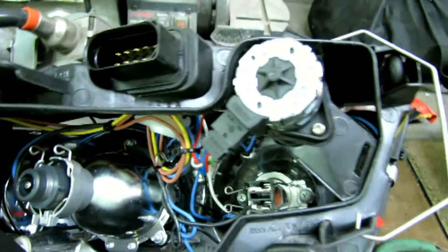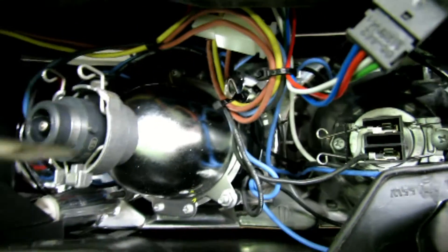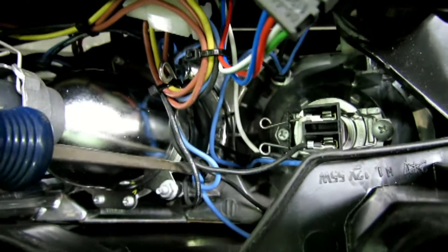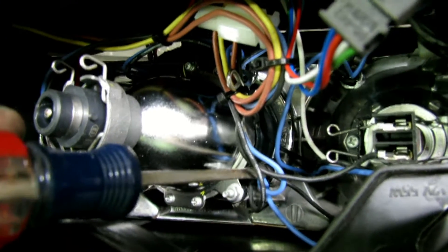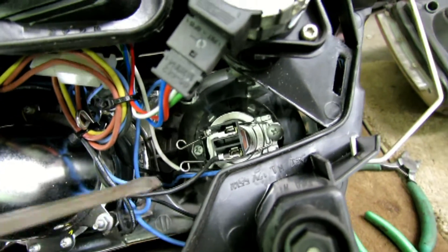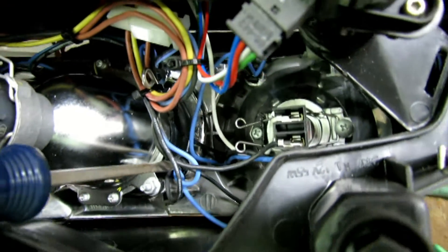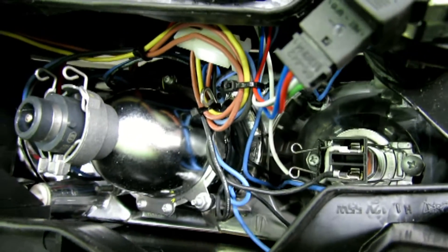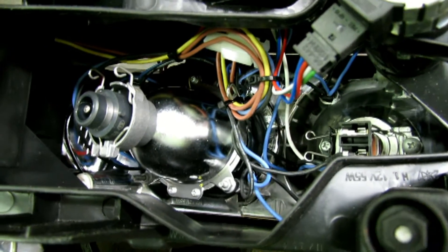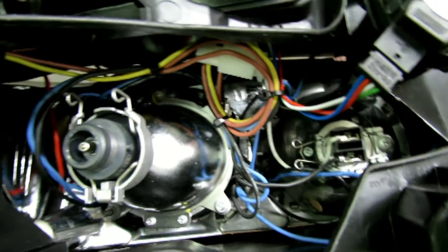Another tip: I changed the halo lighting from the original wedge-type incandescent mini wedge lamps. These blue and black wires and their associated sockets are what hold the lamps. I thought cool white halos looked better, so I pulled them all out. The retainers that hold the sockets into the headlamp assembly behind the halos are not very solid, so I added a dab of contact cement to each one as I slid them in to make sure they wouldn't come apart.